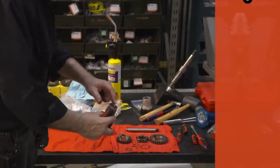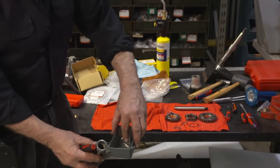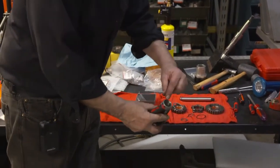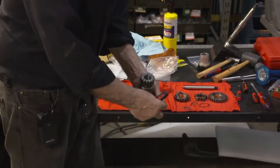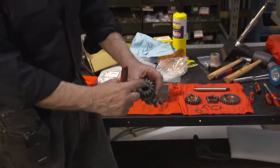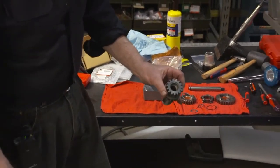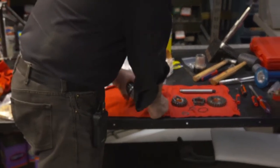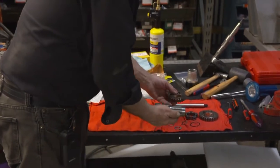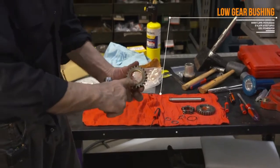Henceforward, we will grease this inside and manually install the same rollers in each side. So each side will get that thrust washer against the retaining ring. We will then grease the area and manually install the needle rollers themselves. Once that's completed, we've got the assembly of the adjacent gear with its respective bushing.